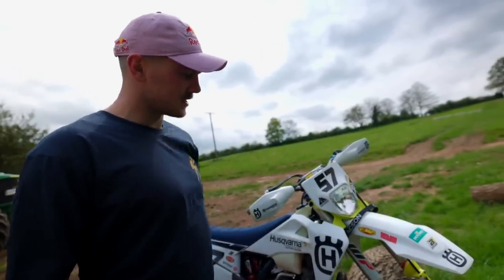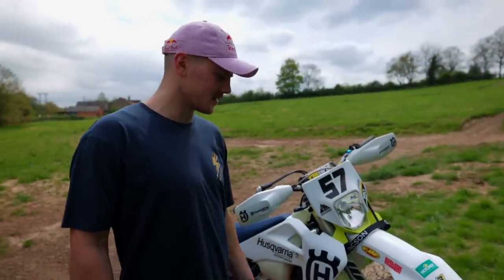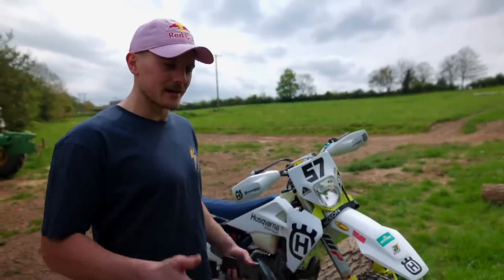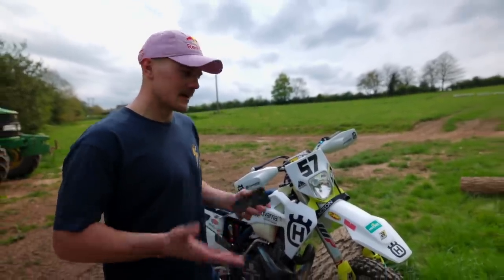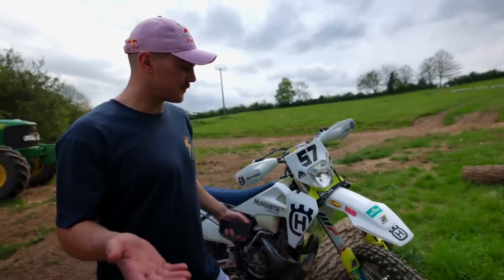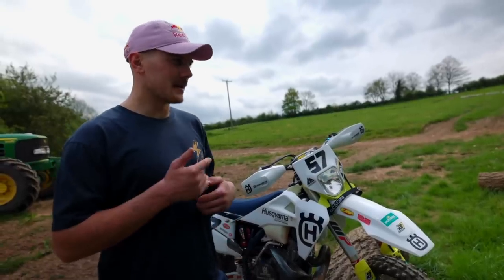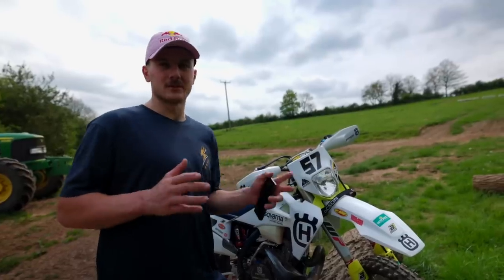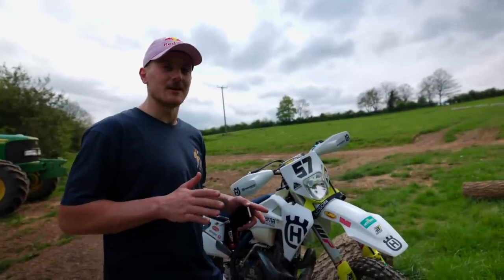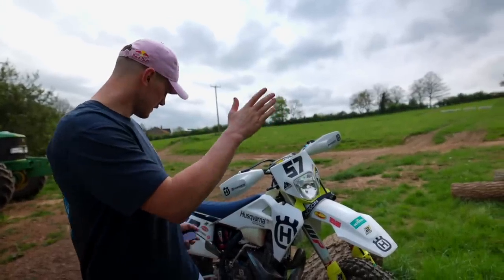For Xtreme I have my setup reasonably soft - very soft in fact. I can't even remember what fork springs are, it's that long since I've ridden a two-stroke properly. I haven't done any testing yet this year because I did Super Enduro and then I've had a bad wrist. Very soft and reasonably fast on the rebound so you can move the bike - it gives the bike quite a light feeling. Having the fast rebound, you've got a counterbalance that we're expecting to be kicked quite a lot. You're never ever going to have perfect suspension setup because there's that many different elements to a Hard Enduro race. You can gain more time on the difficult sections than you can lose on the fast sections.